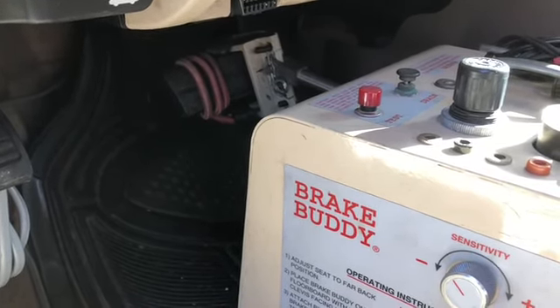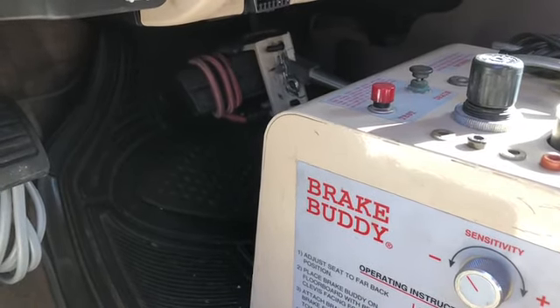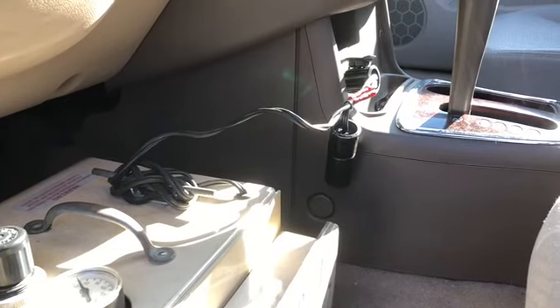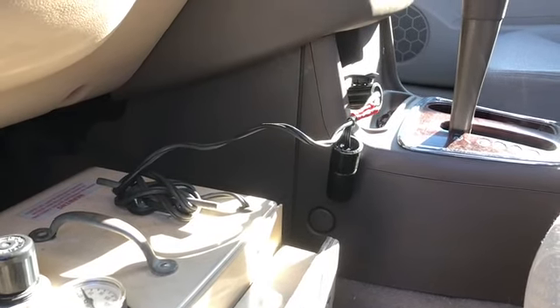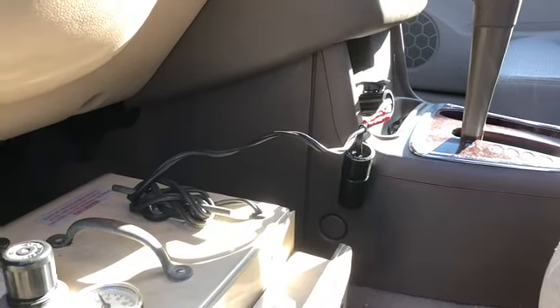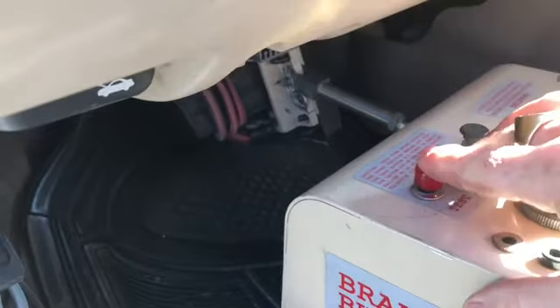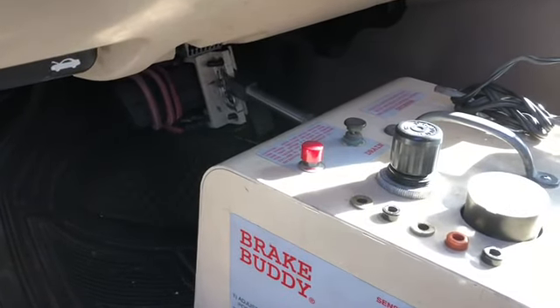Once this thing is plugged in, the air compressor's full and it's ready to go. It does an interesting job by way of a simple tripping mechanism to engage your brakes. I've chosen Betty White because she's a 2007 — that particular year for this particular car model allows no limitations for how fast you can go or if you can tow in neutral. One of the toughest things is finding vehicles that tow in neutral. So it's charged up, and if you watch when you test this, it literally engages your car brake. That's how it assists you in stopping the car-bus combination.